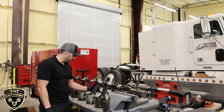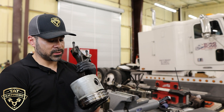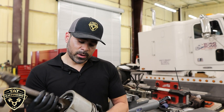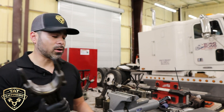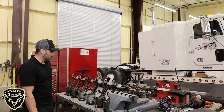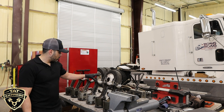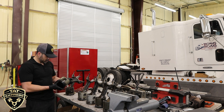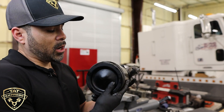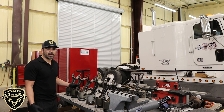This is a lighter dome with an aftermarket part number — definitely an aftermarket piston. When replacing pistons, I suggest going with original parts and always replacing the rod bolts. I can see Detroit numbers on some and FP numbers on others, so these are different style pistons mixed together. Also, there's a lot of moisture on the top of the domes, which indicates the injectors are not firing well.